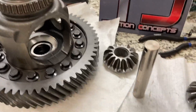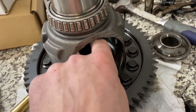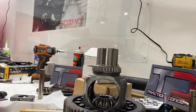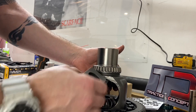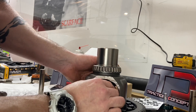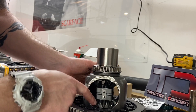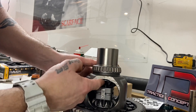What I found to be the easiest way: take one of the axle gears and just put it right inside. Then take another axle gear with the clutch on there and put it in. Because of how much we've clearanced, this goes right in. I've seen other videos where they rock one of the gears back and forth at an angle, but this casting will not allow that. I wasted so much time trying to get this in that way — but it's clearanced, so it should fit right in. Just put one on the bottom, one on the top, and it goes right in.